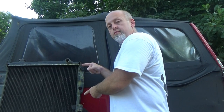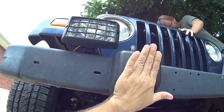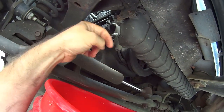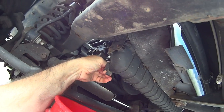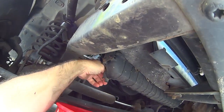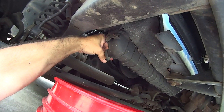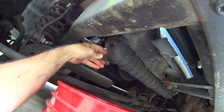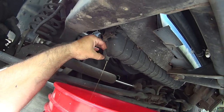Let's get on with the video. Right under here is your front bumper — follow straight back, here's the frame horn, and here's the bottom of your radiator. That's where you drain your radiator. Let that drain while you're doing everything up top to save yourself some time. Be sure to pop your radiator cap too, because it'll form a vacuum inside the radiator and make it drain a lot slower.